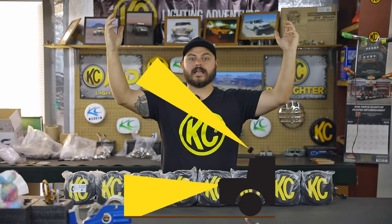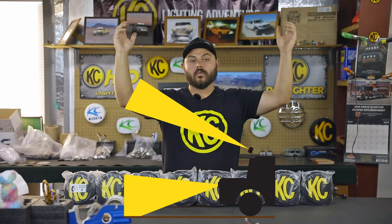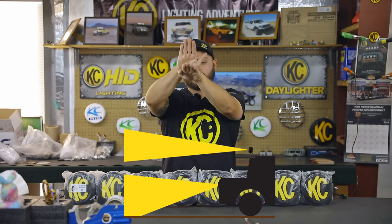Just do whatever you're normally going to drive with — your low beams or high beams — and be on a flat straight road somewhere. It helps to have a little bit of obstacles up ahead, some trees or something along those lines further out down the road, as that's going to help on this aiming process. Really it's simple: go out at dark, have your lights on, aim the light bar too high up at the sky intentionally, then slowly tilt it down until you see that beam. It's going to look like a wedge coming down, slowly beginning to overlap with your headlights so there's not a big dead zone of lighting in front of you. We shoot for roughly a 30% overlap mark.